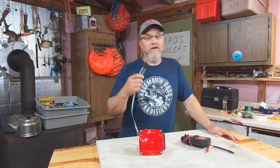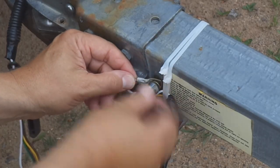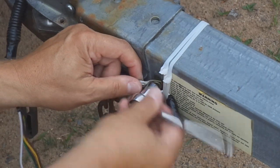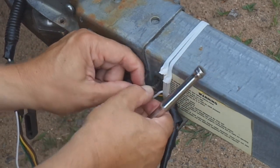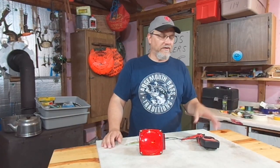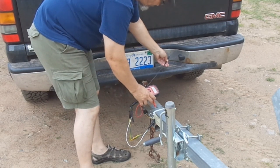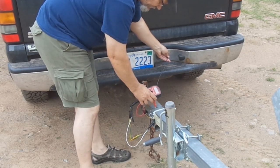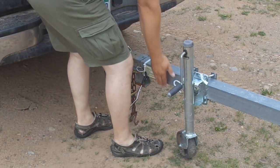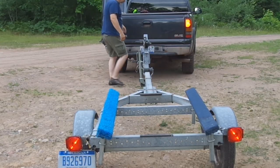Or you might have to go to the plug, clean the plug up, or maybe you have to replace the plug. Now, for this video, what I did is I disconnected the white wire from the frame of the trailer, and that's why the lights went out when I lifted it off the hitch. And keep this in mind if you're checking the continuity from the trailer frame to the truck frame with a meter, right? You guys are like, okay, Knetter said we got to have continuity, a good low ohm reading from the trailer frame to the truck frame for these lights to work. So you check it with a meter, but it's kind of the same scenario. You're going to want to lift the trailer off of the hitch when you make that check to ensure that your meter is reading through the white wire, which is designed to carry those other circuits.